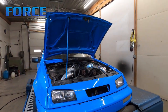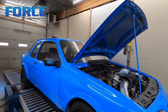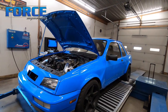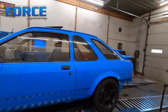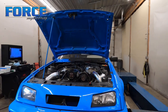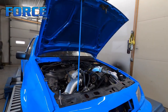That's a 48-pound-a-minute turbo, so it's in the 450-480 flywheel horsepower range maxed out. We're seeing some airflow limitations RPM-wise — it has a Bow Port 1.5 camshaft and big valve head. The turbocharger is our primary air pump here, so a fuel pump upgrade should get us to this setup's max. It does spool relatively quickly which is great for an autocross car. After that, we'd upgrade to a larger turbocharger if he wants to move his goal from 300 to 400 wheel or whatever his future ambitions are.